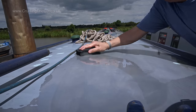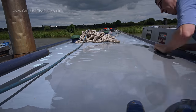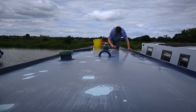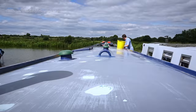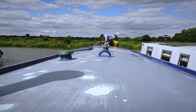I used wet and dry sandpaper because it worked much better than just the dry stuff. This took a while so, like a lot of this video, I've speeded up the footage. Well, that is a good job done — the whole roof sanded and only a mild amount of blood on my fingers. I noticed a couple of tiny little rust spots that I must have missed before, so I'll just sand those and prime them, and then hopefully all is set for painting tomorrow.